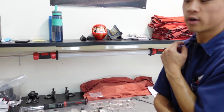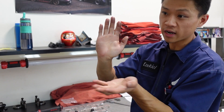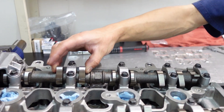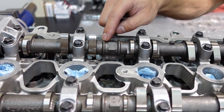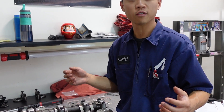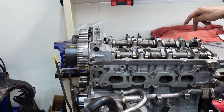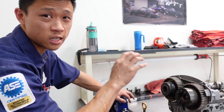Why is this important? Because I know, for example, on a Subaru FA engine they want these at a certain position — not at the bottom of the lobe, there's another position that an FA Subaru engine wants. So if you try to do a valve adjustment on a Subaru FA at the bottom-of-lobe position, your valve lash measurement would actually be incorrect. It's going to be different for every engine — I know it's not like this on a 4A. That's why it's important to do your research and look very carefully at the service manual. So we've turned the cams 180 to do the other set of measurements.